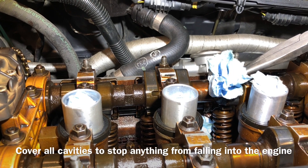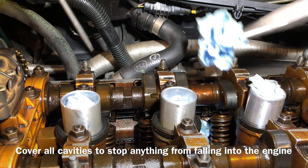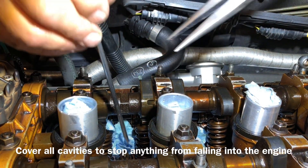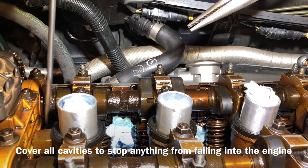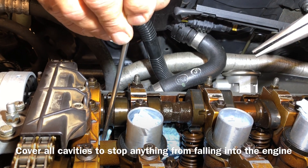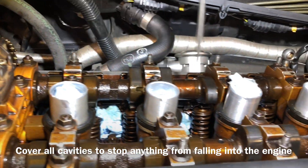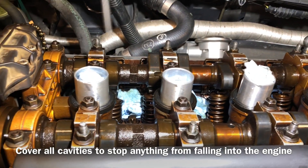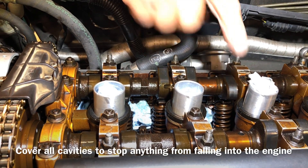I'm going to show you how to set valve lash on an S54 BMW engine. First thing you want to do is cover all of these little grates here with some kind of paper, because if you drop one of these little shims or pucks it can go down to the pan — very disappointing. Don't forget up in the front there's a small hole that also goes to the pan. So first thing: plug off all of the oil galleys that go down to the pan, and plug up all of the spark plug holes. Get your spark plugs out.